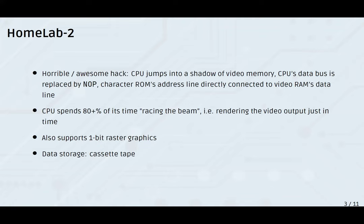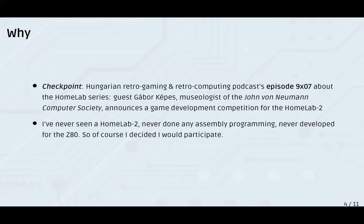In this one you have to turn it off for cassette files, not just for timing purposes, but because one of the address lines is shared with the video. But in practice, it doesn't really matter because you have to turn it off anyway, because the cassette input is all done in software. So the timings are very important to measure how much time passes between spikes on the tape.